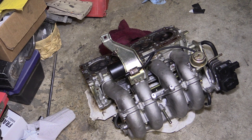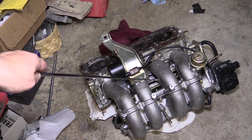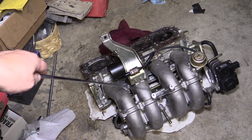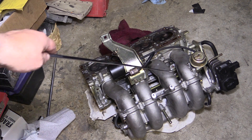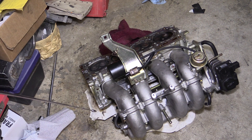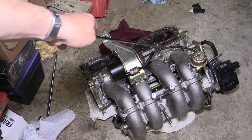One other point about the cylinder head removal process: it's not necessary to remove any portion of the intake manifold while trying to remove the cylinder head on the QR25. In fact, in some ways it's easier to just leave it on. The only thing to consider is a bracket that bolts on the back of the engine — it's a little tight but uses two 10mm bolts you have to undo. Then unplug everything else connected to the engine components and the cylinder head should come right off. At that point it's much easier to unbolt the entire intake manifold and take it off that way.